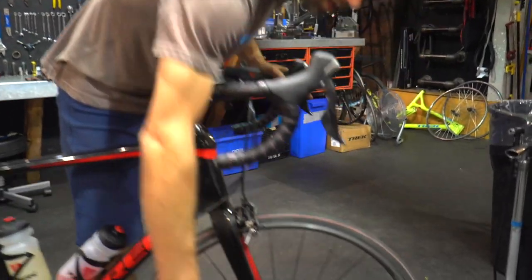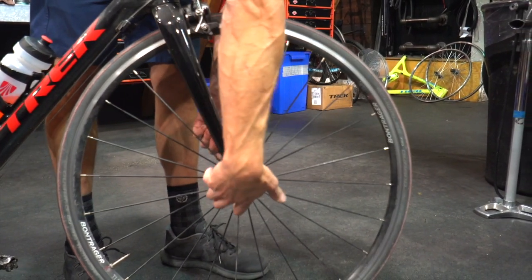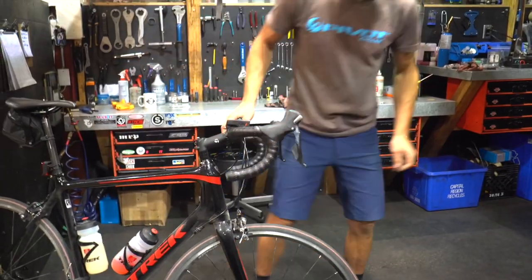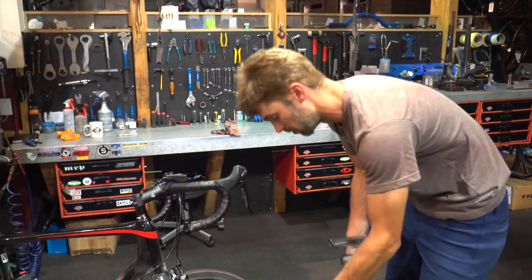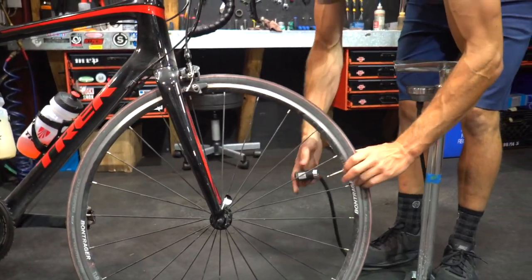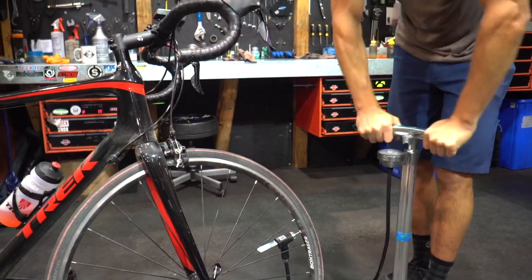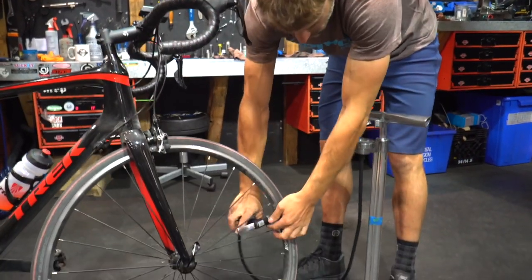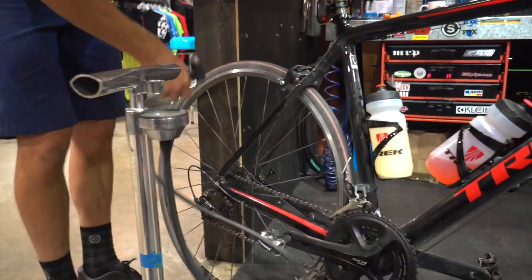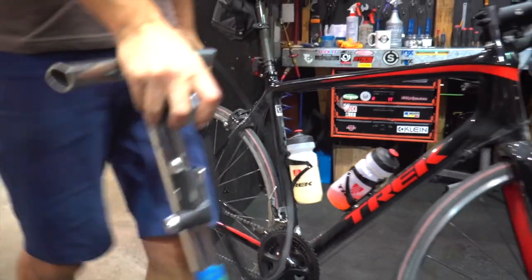Obviously quick releases as well — we do see a lot of people coming in with these loose. Just make sure they're snugged up. That one's a little bit loose there. It should be difficult to close but not impossible — you have to put a little bit of force into it and it shouldn't pop. That's pretty good now. And then of course before most rides you'll want to check your tire pressure, especially on a road bike. With such low volume tubes they lose a fair bit of pressure relatively quickly — if it's been a week, check your pressure. Jesse was down to around 50 psi; now we're up to just over 90.